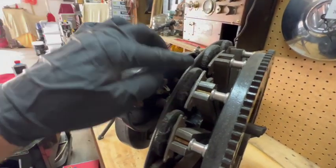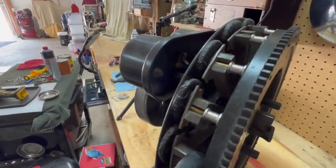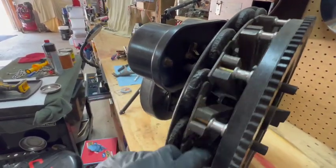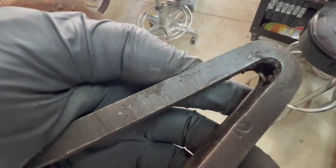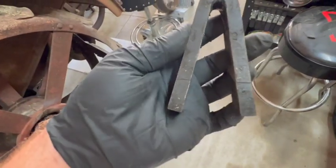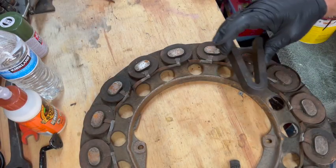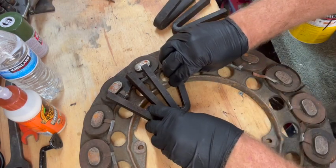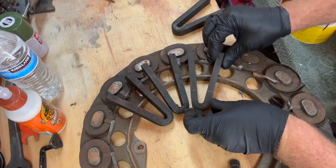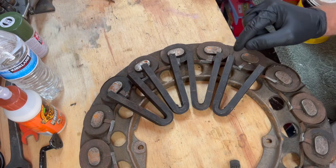Here's sort of what we're dealing with. These are the copper field coils right here, and these are the feet of the magnets all the way around — there's 16 of them. Each magnet has one north pole and one south pole. Here's what a magnet looks like; this one's even still got the Ford logo on it. This is an old mag ring that I had laying around, and the magnets go something like this all the way around. The like poles of each magnet are supposed to be next to each other.